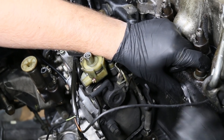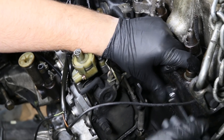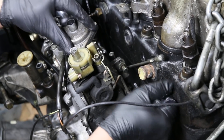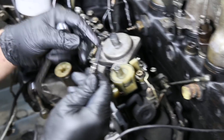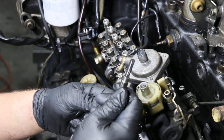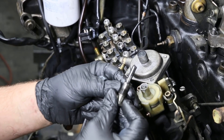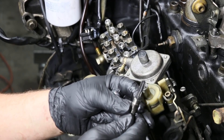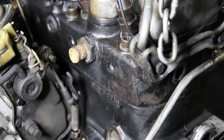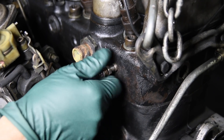You don't really need to torque it. Just get it so it goes down and it seats. Let's pull that baby out and see what we got. Rotate it around so everybody can see how much carbon is on the flutes of that reamer. Isn't that amazing? I bet you're going to find that same situation with all those other pre-chambers. Once the chamber's reamed out, look at how much easier it is to install a glow plug — you just push it in and it threads right in.